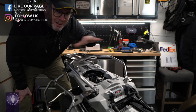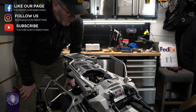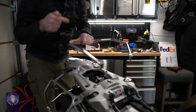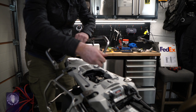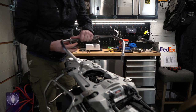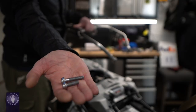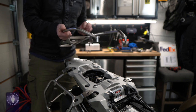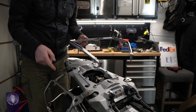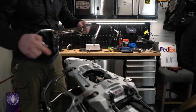I've actually already dismantled the back of the bike. I apologize - I'm not going to put it back together and then undo each screw for you. When you take the seats off your bike you'll see one, two, three, four bolts holding down the grab rail. The front two bolts are identical and the two rear ones are slightly shorter. The Torx size for those is T40 - so that's a T40 for all of the bolts holding on the grab rail.